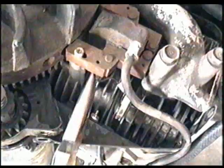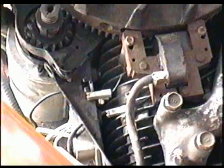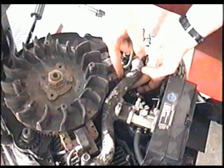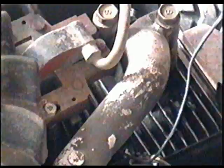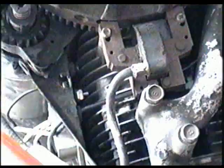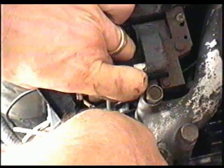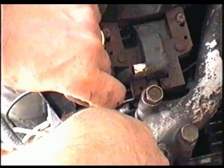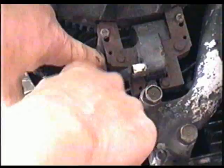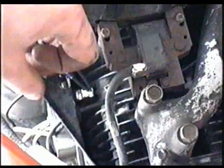Now what we need to do is remove the wires from the coils — there'll be two of them. We need to remove these wires from each ignition module; they're plugged right underneath. Now the other ignition module — the wire is right underneath over here, so just work it back and disconnect it from here as well. Now grab your new part and with the tab with the hole in it, screw it in toward the other part of the tab down there. There's a little washer that goes here and a nut. Make sure you don't drop that down there — if you do, just shake the cowling on the sides and it should come out the bottom. I'm just going to tighten up that nut there and this will be nice and secure.